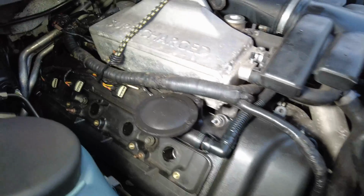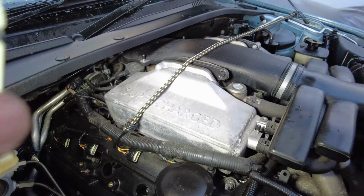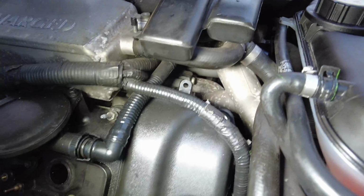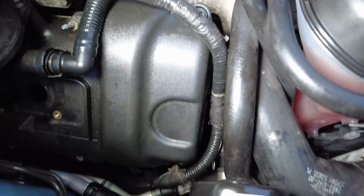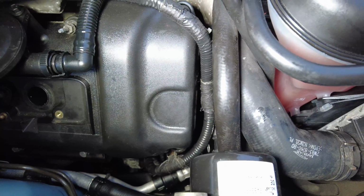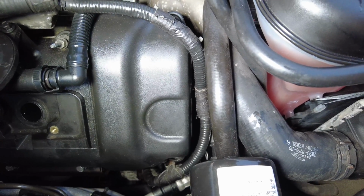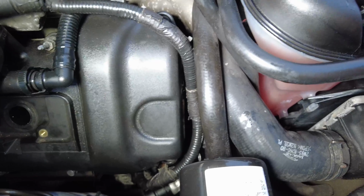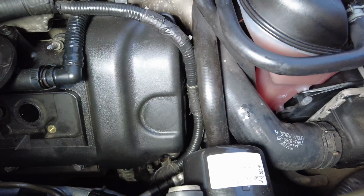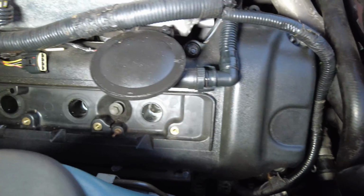So I've been able to remove all of the screws here. I've got the wiring harness just hooked there with a bungee strap just to keep it out of the way. Point to note, down here there's an 8mm earthing strap which is on the other side of that wiring loom. Quite a pig to get to, so I ended up having to get out a flexible wrench ratchet, an 8mm one, to try and get behind there, and eventually it came out. It was pretty much seized in, so I had to use some WD-40 penetration fluid to ease that and leave that for a couple of hours.